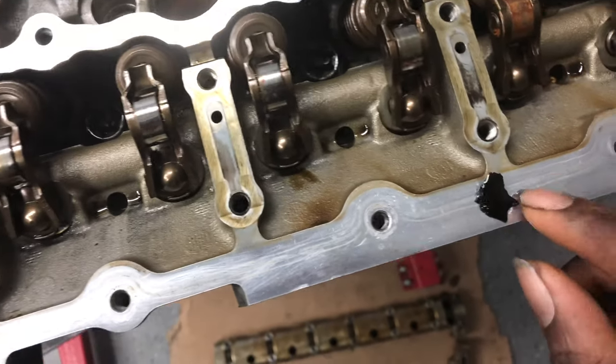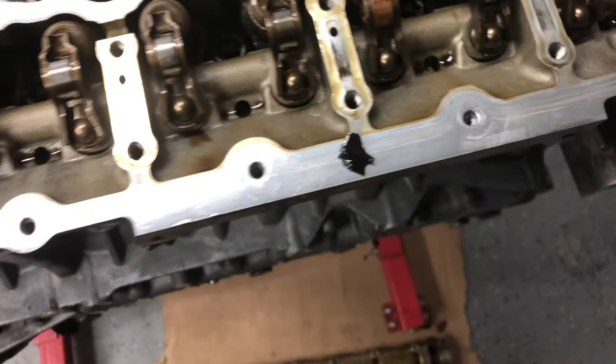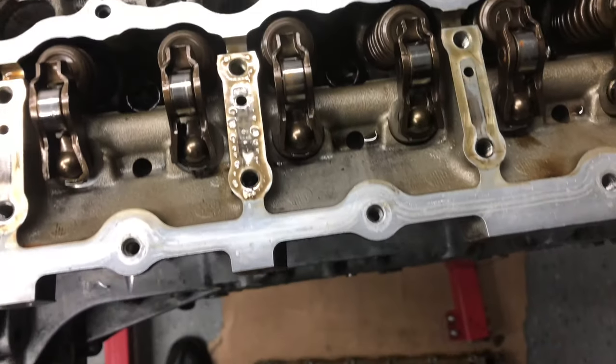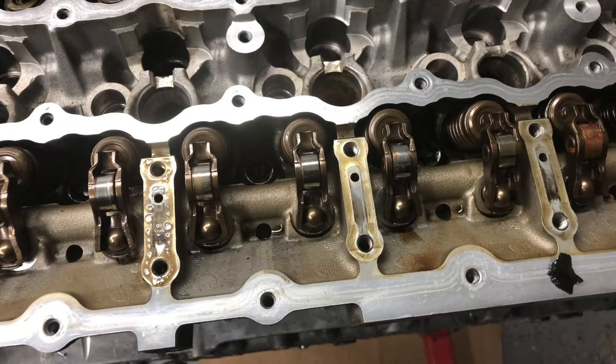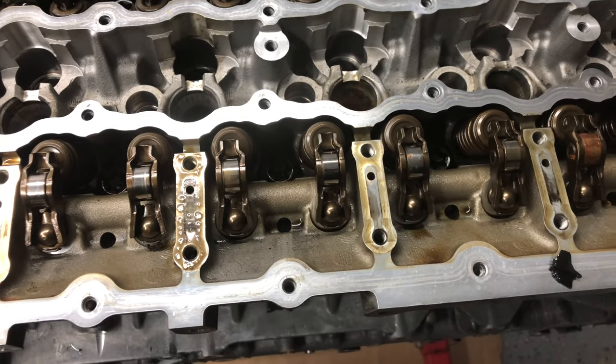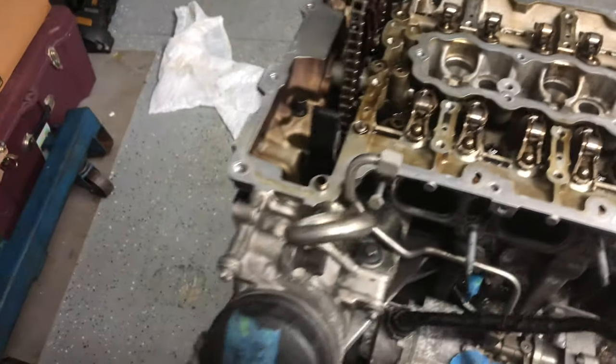This is where I found a piece of — what is this — plastic. It seemed like valve cover material; a little piece of that fell into the engine. Ironically it's on cylinder 3, and that's the side that was having the constant misfires — it wouldn't stop misfiring. So I'm pretty much ready to take the head off.